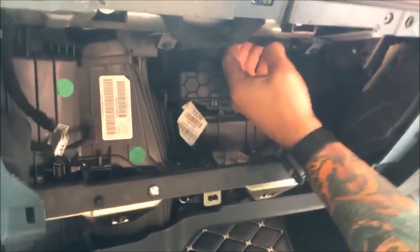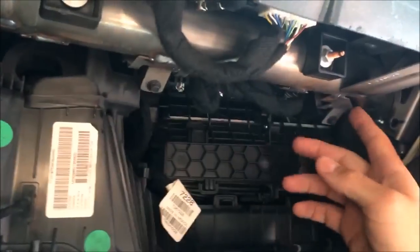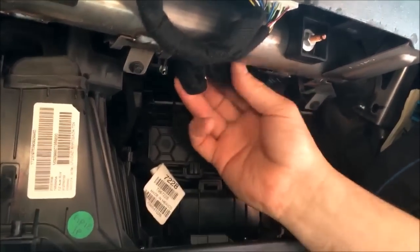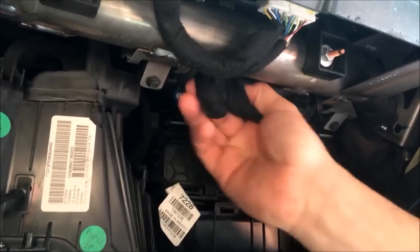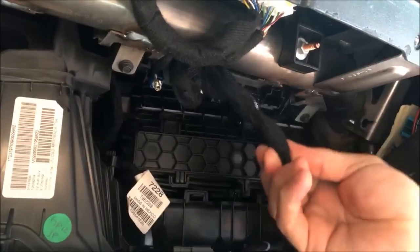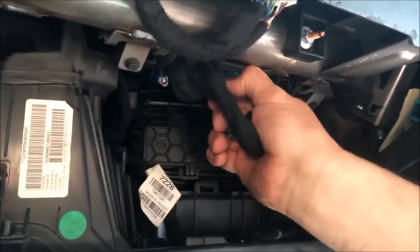Again, this will come all pre-programmed. So what you want to do here, this HMI is held in there by some release clips on each side. Easiest way to release that, don't unplug these. Use your harness. You can see that just came down loose. I just took it free from the release clips. I'm just gonna unplug one by one.